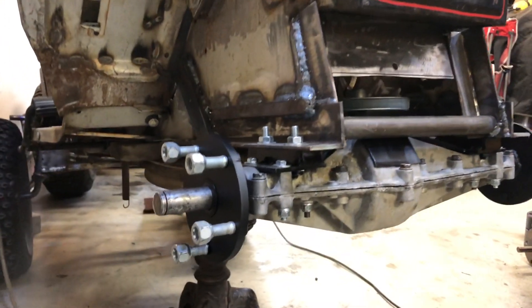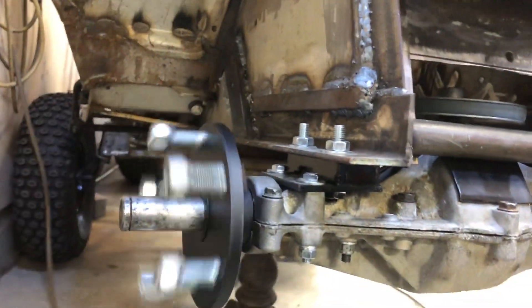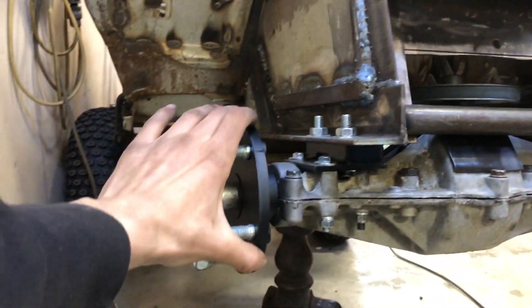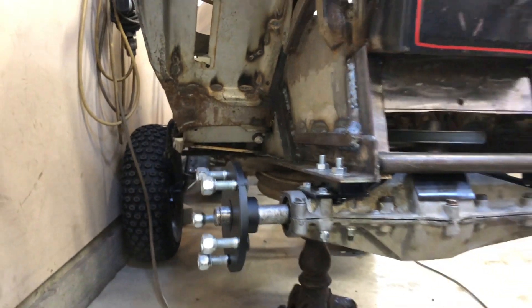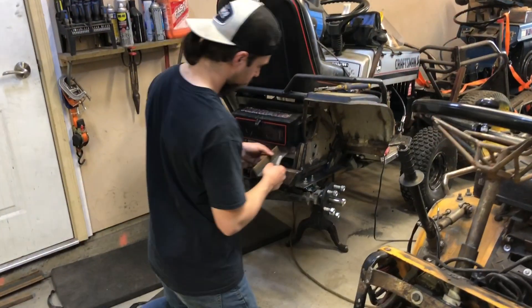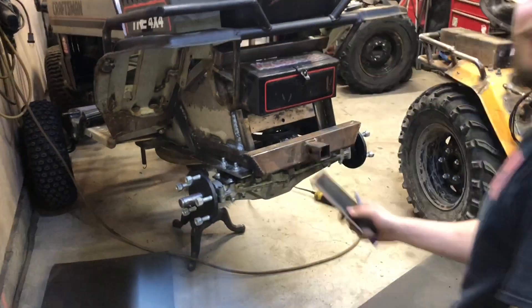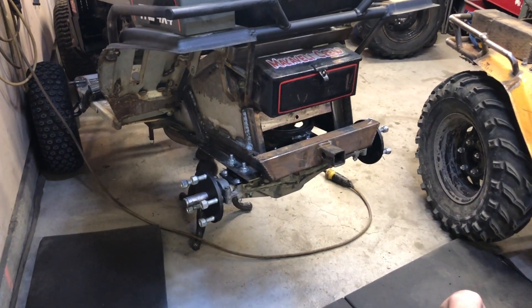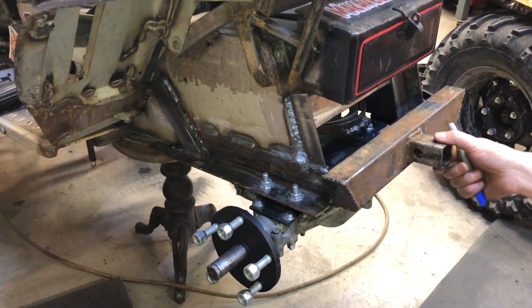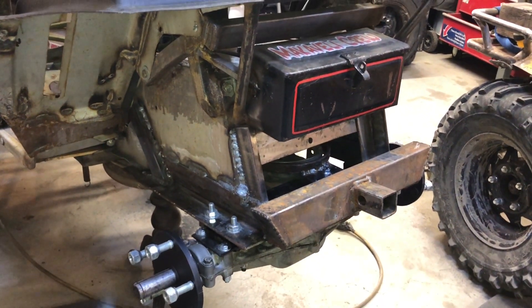These are freaking baller — we run these on all our rigs. We just got to put a keyway in and then figure out our spacing on the shaft, probably going to run them out at least that much if not a little more. Tony's plugging away making another couple brackets. As you guys can see we got the back bumper on — just tack welded in place but it's looking awesome. It's the same original bumper, just three and a half inches back from where it was.